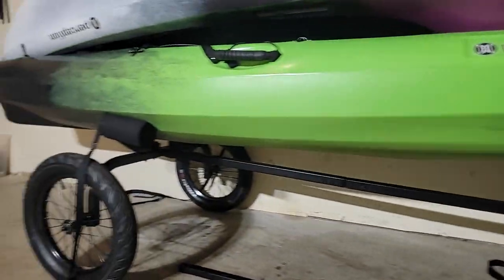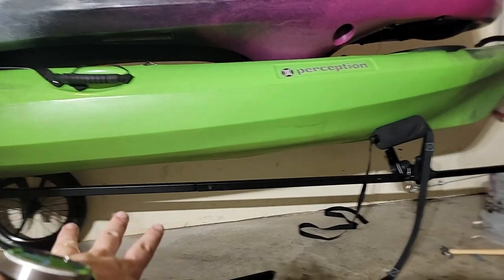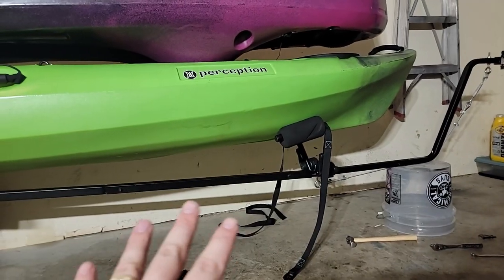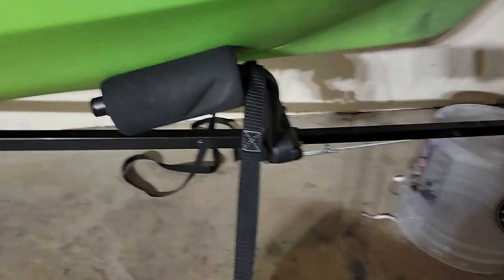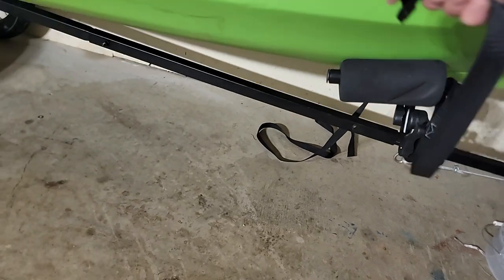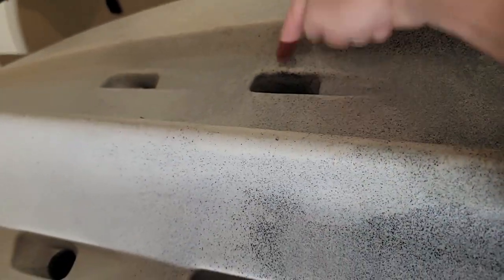So that's where we're sitting as-is. Previously you'd notice a substantial bend in between here — you can still see a bend but it's not as serious. These straps come with the trailer with the cam buckle. The way I rigged them, I put them on these bars so that when you pull up, it's actually pulling those cushions up against it and keeping the tension. We do have a sag problem, so I come up and over, down through, and back through here — same on the front.